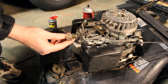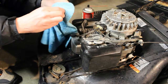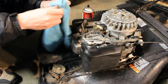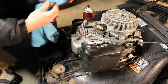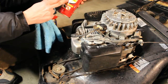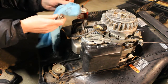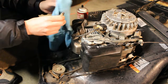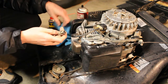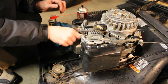We've cleaned up the spark plug and it looks a lot better. I'm not going to make it perfect but I've cleaned it up as much as I can — used a wire brush and a little QD electrical cleaner. Brake cleaner will work too, anything to get any crud off of it. That looks pretty good. We'll stick that in there for now and leave it loose because I'm going to be testing that.